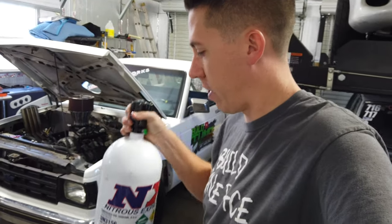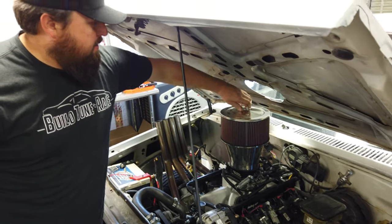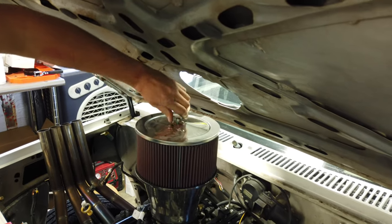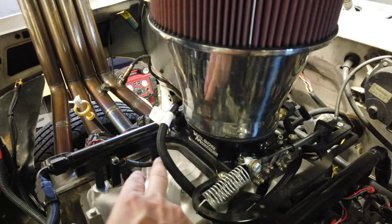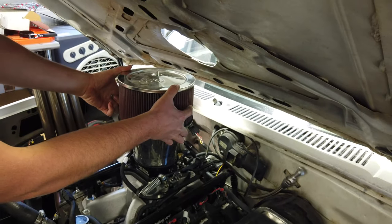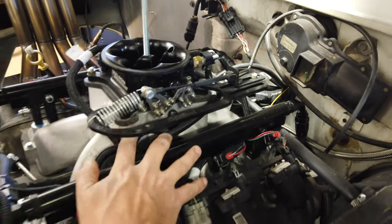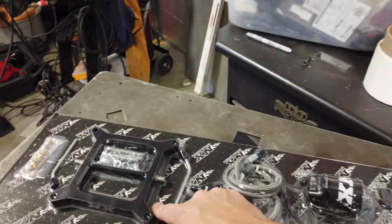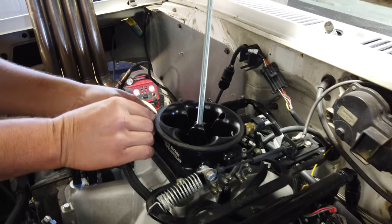Alex is ready for that nitrous life — he's already taking the wing nut off. We got to get that air cleaner off of here, get the throttle body off. It looks like one solenoid will sit here, one will sit back there, run the wiring in with all that stuff — shouldn't be too bad. We're going to go ahead and get that pulled off. We are going to end up probably ditching the spacer here. This comes with two gaskets and it's nice because it comes with the hardware too — the longer hardware to go through the plate. So all that stuff should be good.